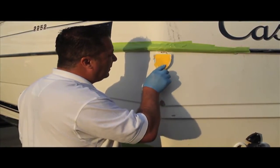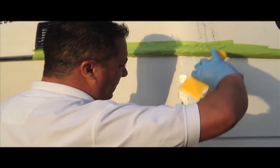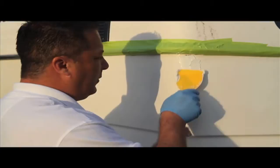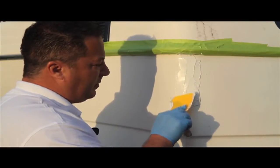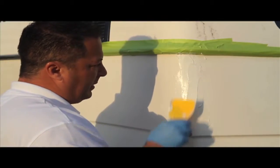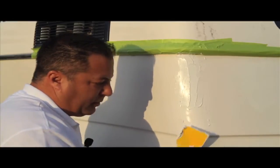I'm going to apply it right here — just like that. While I'm doing this, you can actually color match the boat with the putty. So if you have a blue boat, you can actually get blue pigment and throw it into your cup. That way, if you spray and you happen to go through your spray area, you will not see the damaged area.